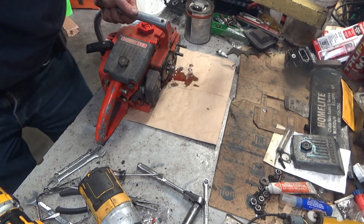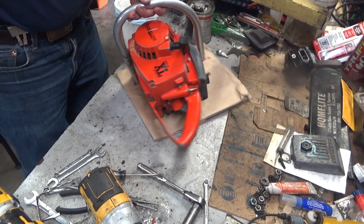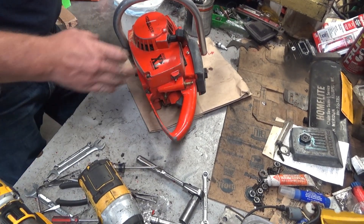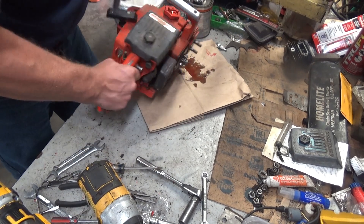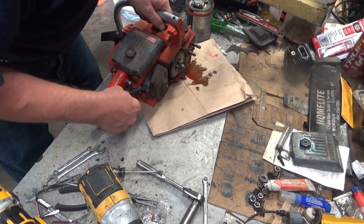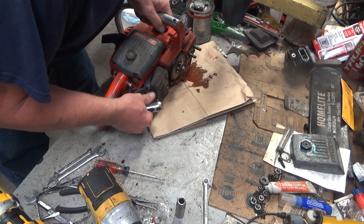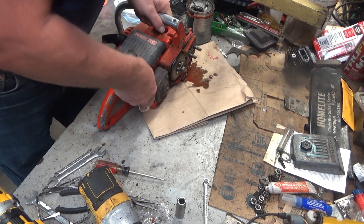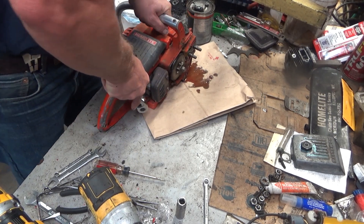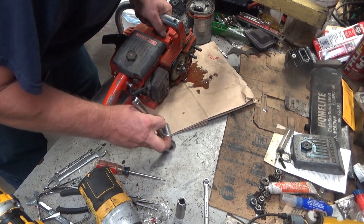Obviously the oiler isn't a problem. Did you guys hear that popping and banging? There's an ignition problem in this saw, and with where it's cutting in and out at the RPM level, I'm going to take a wild guess that it's got a condenser that's going bad — but we'll have to get it apart to know for certain.